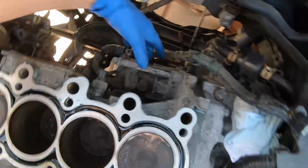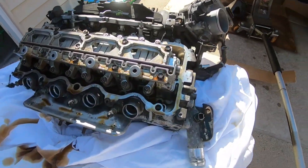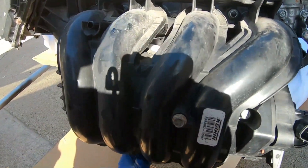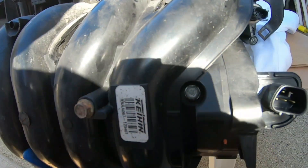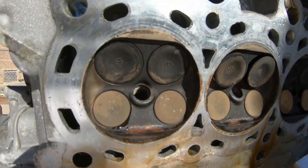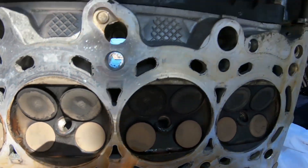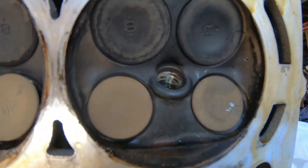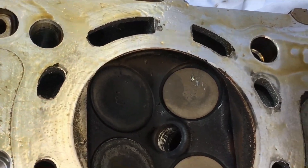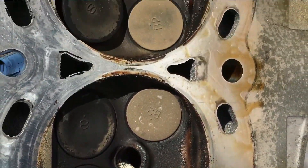Look at the engine bay — if you want to replace the starter or power steering pump, now is your time to do so. Here is the head. The good thing is we were able to keep the intake manifold in one piece with the head for simplicity. The valves are all there — they're not chipped, which is a good thing. Don't worry about some valves being open; that's just valve overlap since we have the camshaft in place. Cylinder 1 right over here, all the valves look good, no chips. The sealing can be questionable of course — we're not testing for sealing — but overall the head looks good.